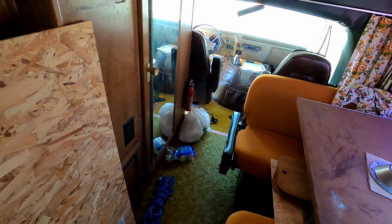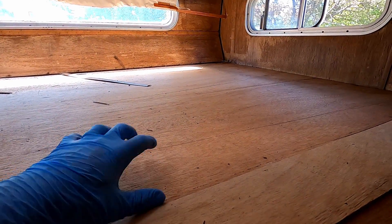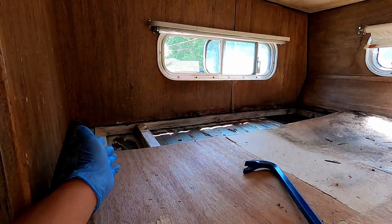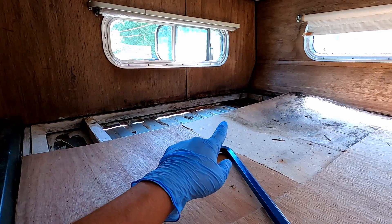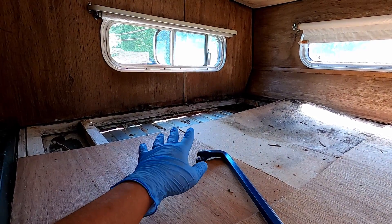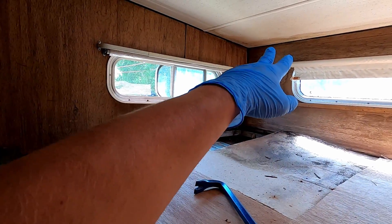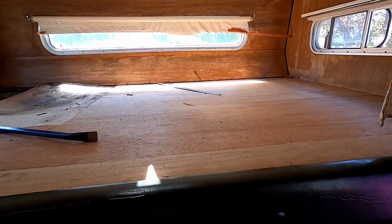Today I want to do some other small fixes, but I decided instead this top bunk here has some really thin, cheap, like wall board type stuff. It's really bad. Definitely been water damage up here. So I just started getting into it — I'm going to get out the whole frame, see what the frame looks like. You can definitely tell it's wet over here, but it's not completely rotted, which is shocking because this looks like original. Maybe they've already done this before, but the whole bottom here you can tell there's mold. I'm probably going to take out that whole wall just to start from scratch up in that corner. So I'm going to rip out all this right now.